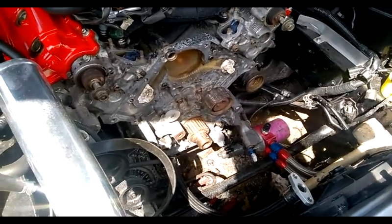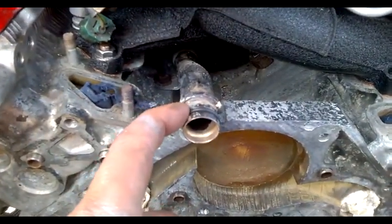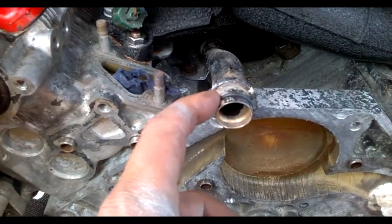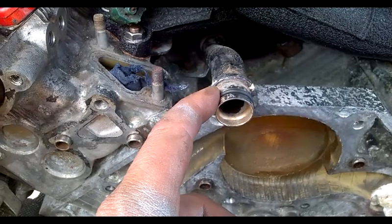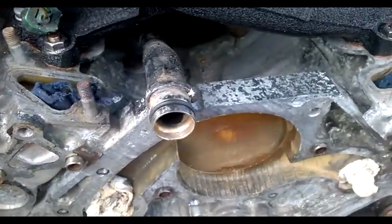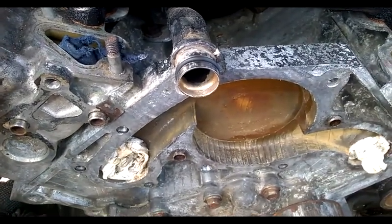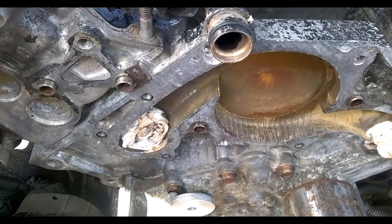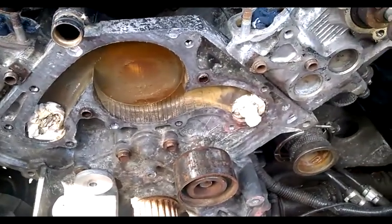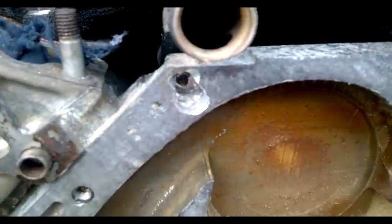That's the feed and drain for the turbocharger. Anyone wanting to know: if you damage the o-ring when taking your water pump off, go with a 2.5mm cross-section by 18mm Viton o-ring. I do recommend any o-rings you replace go with Viton — they are far superior to standard o-rings which will just perish. That's the update so far; still got some cleaning up to do and sort out that broken bolt.